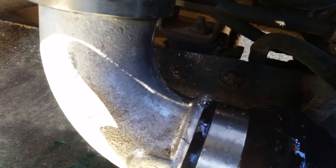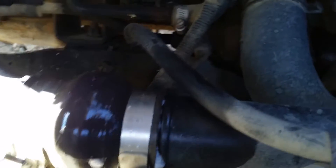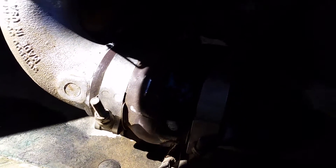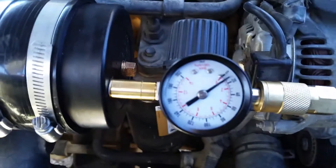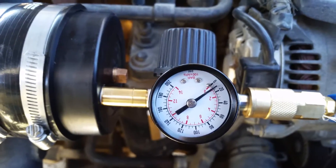What I'm spraying on there is Windex — you can see it leaking. If that was 20 or 30 psi I think it'd be puking like crazy. There's a leak there, and another leak right here in the middle of the boot — actually on the boot mold seam, but it's leaking. This thing is leaking around that joint, and even leaking on this joint here too. Give the Windex a minute to settle but once you spray it on it bubbles really well. You could use soapy water too.